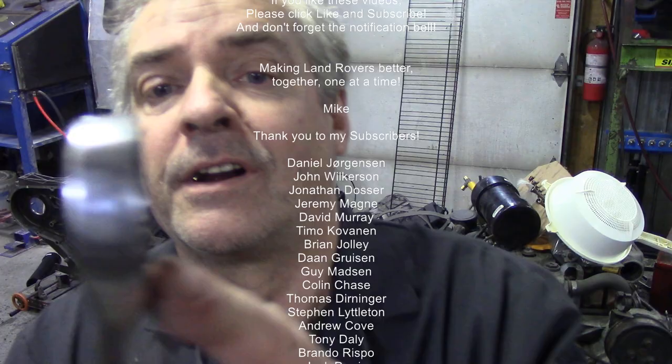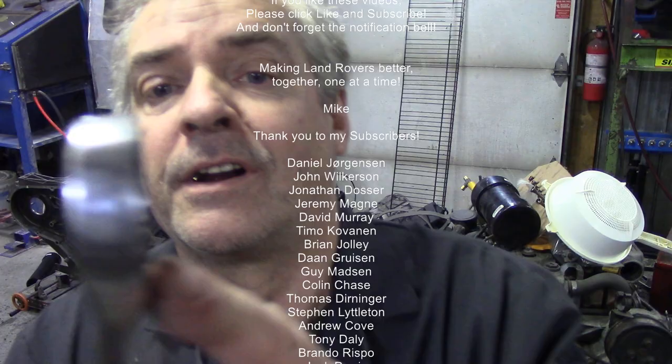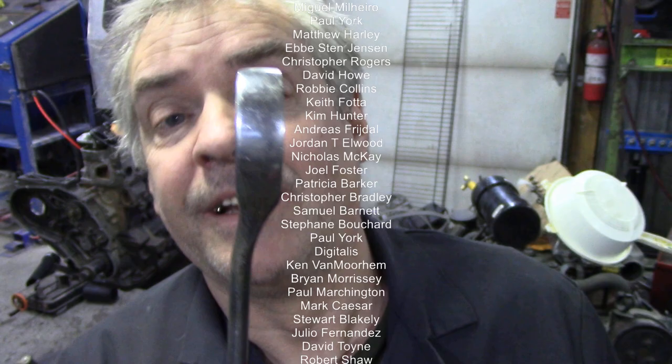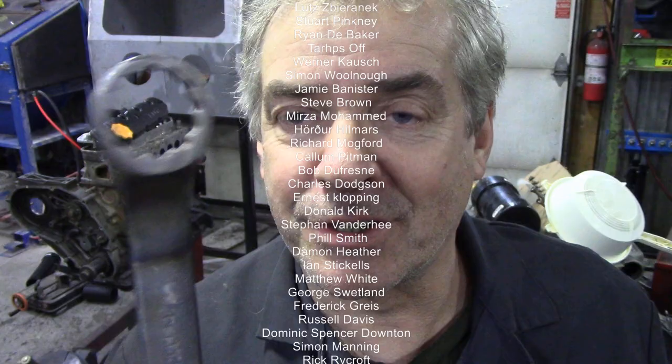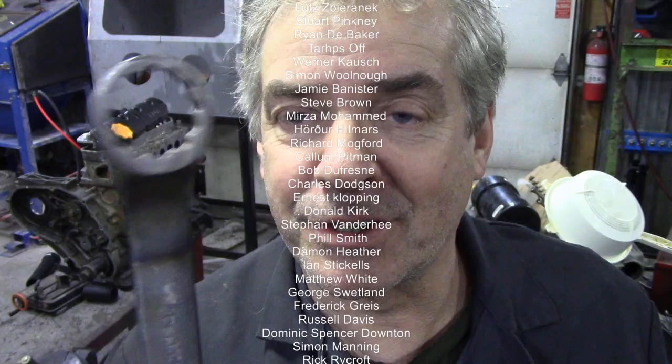You can have a double-edged sword with this 32mm spanner. At the other end, if you grind the flat off so there's no lead — usually there's a nice big lead but you never really need it — grind it flat so the internal is parallel, because normally spanners are at an angle. It's an excellent tool for getting sump plugs out of 300 TDIs and R380s. You've got plenty of leverage, and you can also hammer it here to knock stubborn sump plugs out.